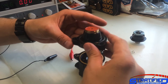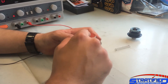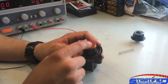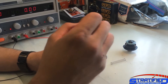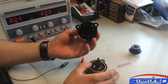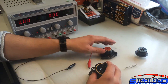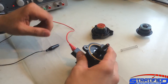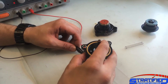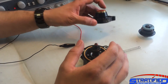The mode of operation for the outer piston is similar - through this small hole, boost builds up on the other side of the piston, holding it shut. As soon as you lift off, the solenoid is actuated, the plunger moves back, boost pressure escapes from the back of the piston, and the piston gets pushed down. Using a power supply you can see it actuated and then released to seal back up, and once again actuated and then released.